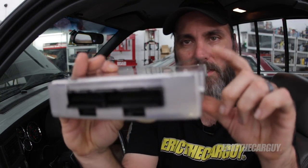Well, viewers, that's going to be a wrap on this episode of ETCG Dad's Truck. Now, there was one thing that I wish I would have covered a little more in detail in the video, and that's the removal of the PCM. You don't need any tools or anything. There's just these clips here. So basically, you can just unclip it, just pull it out, unplug it, and away you go. And this is the older style that you can actually go in and replace the prom chip in.